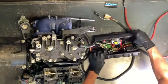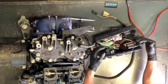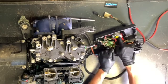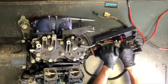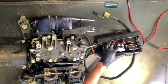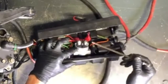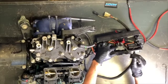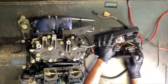We're going to lift these coil wires up. We've got our starter relay here — this takes the power from your switch on the left-hand side of your handlebars, runs it through this relay, and goes to your starter. You should not have power going to both sides when your battery is hooked up. Once you hit that starter button these two will connect and run to your starter. Let off the starter switch and you'll kill power to this post.